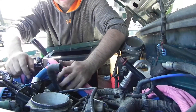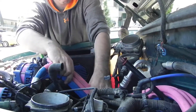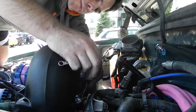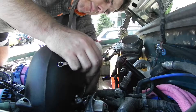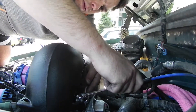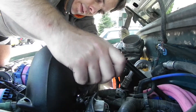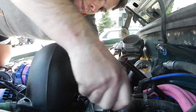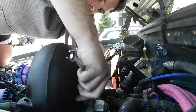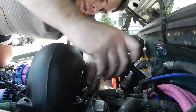This is where I started running into problems again — the new intake was hitting my wires badly, so I'm trying to move them around to get as much room as possible. I ended up having to completely remove my alternate power wires — the pink wires — though I didn't film that part. Here you can see me getting the new intake bolts tightened down. They were a bit of a pain to get started — you can see me wiggling it. Once threaded it's fine, but you can't fit the box end of a wrench or a socket on top, so you just have to use the open end.